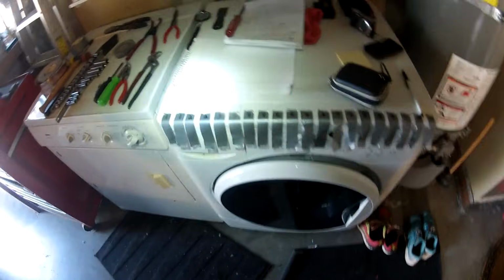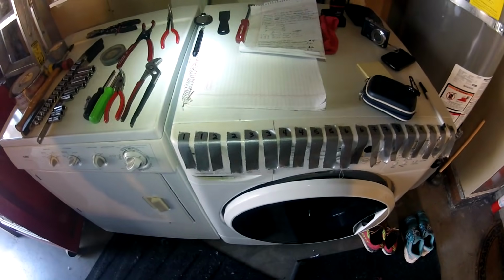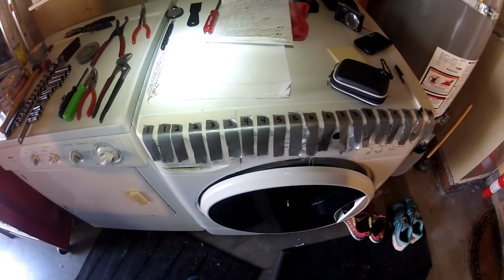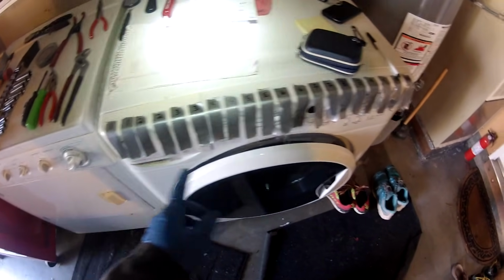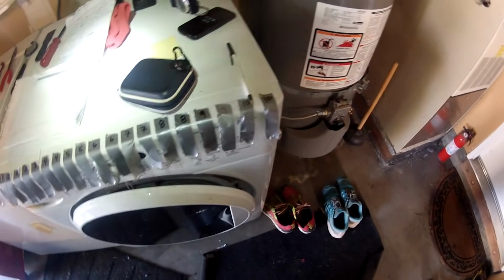Another thing I want to show you guys is that when I did this job on my 2004 runner, I marked all the tube connections and all the electrical connections by putting a corresponding number on the tube itself and where it connected. This way, reassembly was really easy and straightforward, so I wouldn't miss anything.